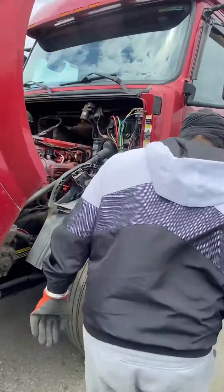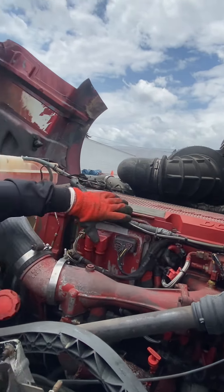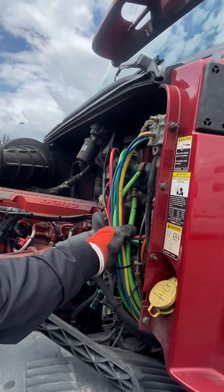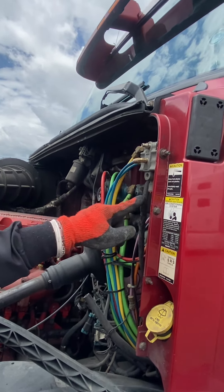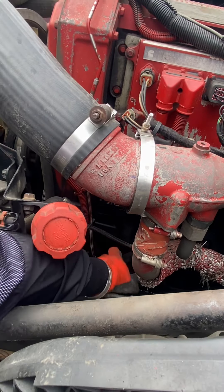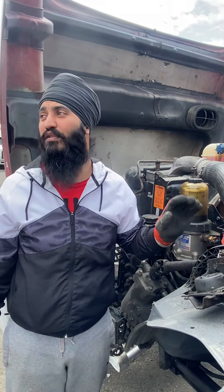My engine top, middle and bottom well mounted — no crack, no oil leak. My all electric wires well connected, no damage. My all air hoses connect properly — no cut, no rub, no air leak. Governor compressor and discharge line well mounted, connected properly — no cut, no air leak.